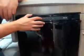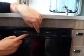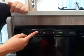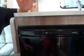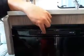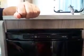You'll likely use electric on a fixed site, but our advice is every now and then fire it up onto gas. To light the gas, just select it and select your temperature. If the gas doesn't light, it'll flash on screen and there'll be a tiny red flashing LED on the on button. To relight it, simply switch the fridge off and then switch it back on again — it will self-prime and self-ignite. You'll know it's lit because it'll return to the normal screen and then go blank.